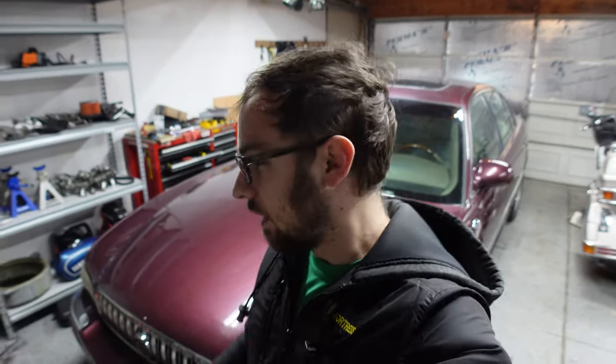So if you remember the last episode where my cooling system decided to unalive itself, you'll have seen at the end that my front trans mount that I just put in two weeks ago also decided that it was tired of this mortal coil, and so now I need to replace it. This is very, very common on these engines when they're making anything more than stock power — specifically the Bonnevilles and the Rivieras, because they have that style of front trans mount instead of the dog bones like the W-bodies have. Those go bad even at stock power. So two weeks with probably 300 horsepower? Yeah, okay, that happens.